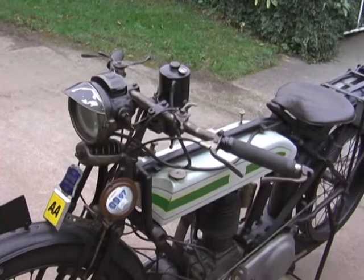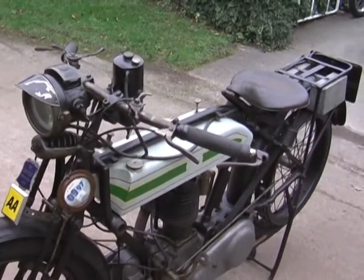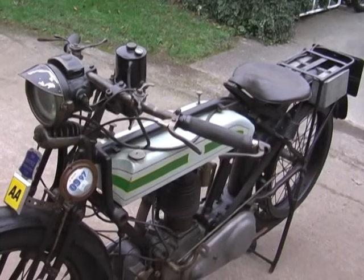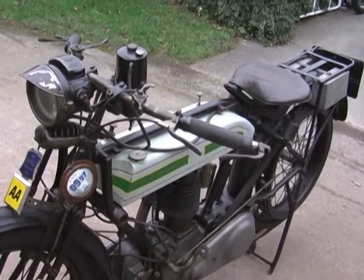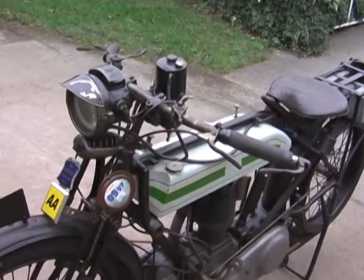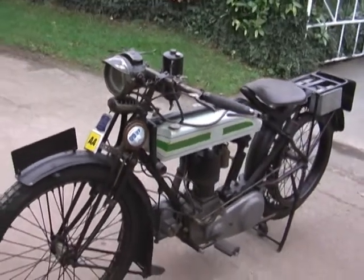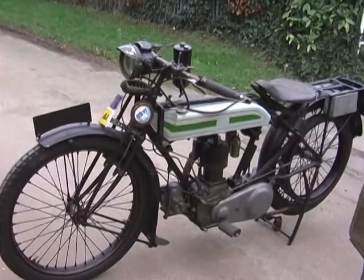There's no springing at all on the back. Tire pressures should be 40 to 50 pounds per square inch — not down to 20 at all — because of the nature of the tire, which is beaded edge. If you ride with 20 psi you can twist the tire out of the rim, and that could have disastrous consequences.